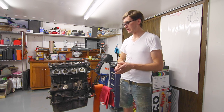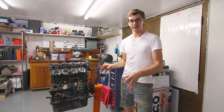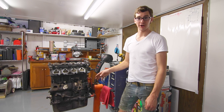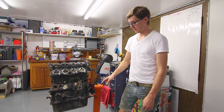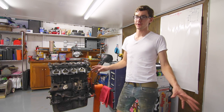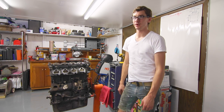Other small items like injector seals, throttle body gasket — those can be done with the motor in the car, so I'm not too concerned about those. I've already purchased the standard four-cylinder Volkswagen windage tray that clears everything properly, and I am converting back to a steel oil pan. The ABF pan is aluminum or magnesium, and even though I'll have a robust skid plate with foam between it and the oil pan, I don't want an oil pan failure.